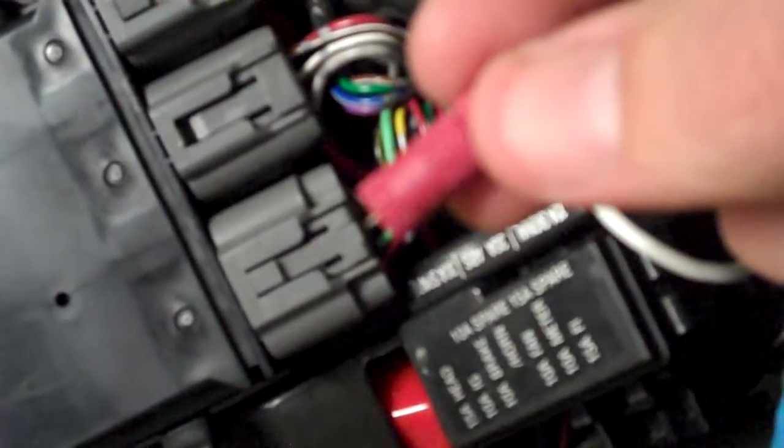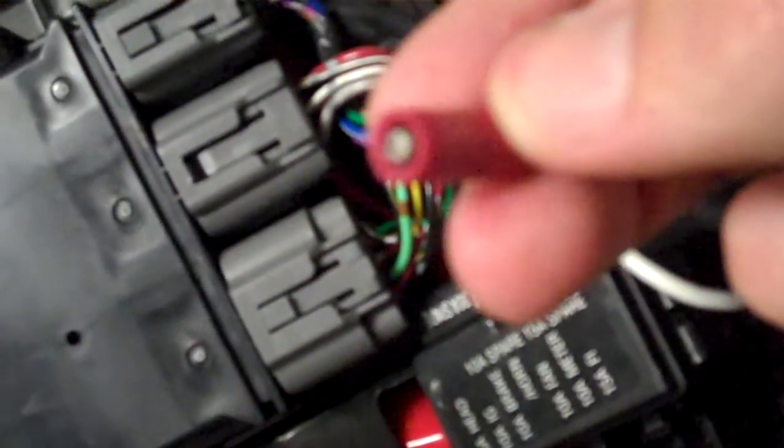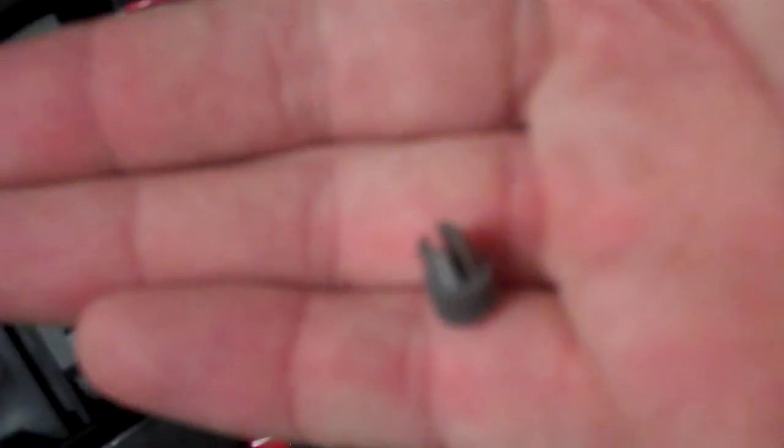Once it's sitting through there, you take this in. There's actually a pin sitting just at the end of that, inside that red connector — it's actually a pin. So what you do is you screw this back onto there. Then what happens is that pin pierces through the outside plastic sheath and the pin touches the wire on the inside. So that gives you your connection.